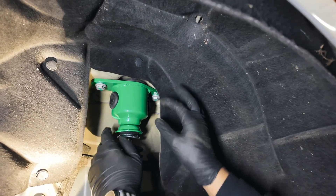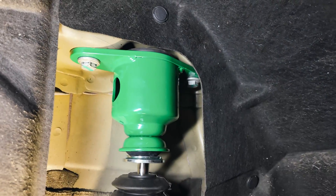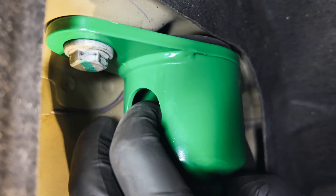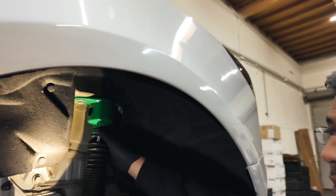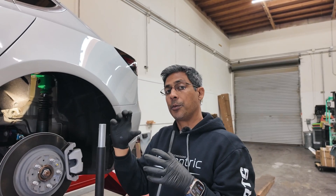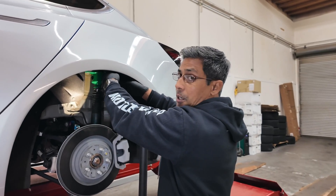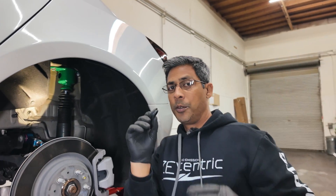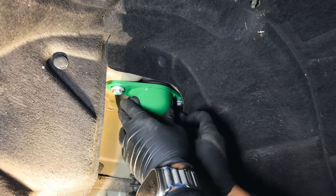Now, Flex Z — this here is your Flex Z. Check this out: you've got two grommets, one on either side. You can get your finger in here, one on each side, and there's the adjustment knob inside. You can use two fingers to rotate and adjust this — you do not even necessarily need to remove a wheel to do that. You could theoretically go up a driveway crooked so one side of the vehicle compresses the suspension and the other side droops down, and you might have enough room to get your hands in above the tire, pop these grommets out, and adjust it without removing any wheels. Then just put the grommets back in to seal it up again.